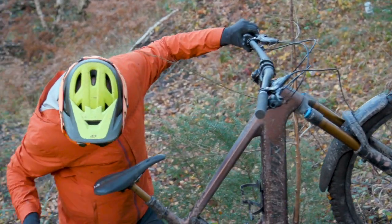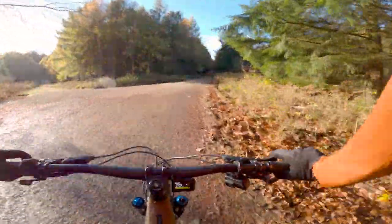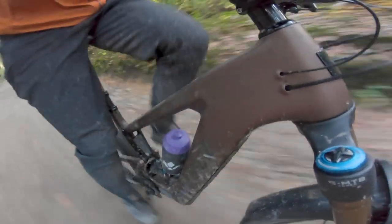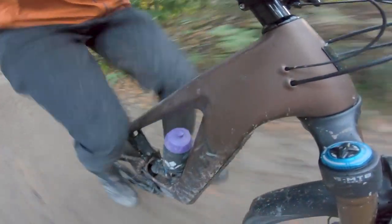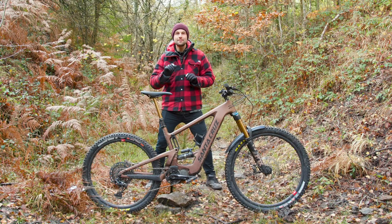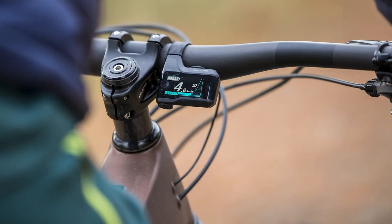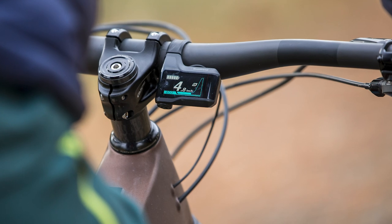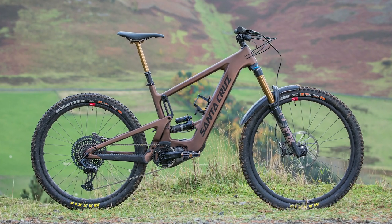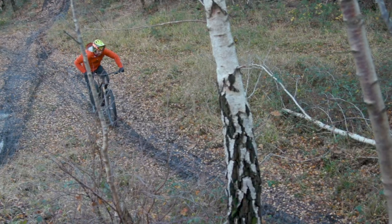Along with the motor, the ascending prowess was helped by the suspension's compliance. Although it would be fair to say that the rear suspension bobs a fair amount under power, especially at lower cadences when standing up, this also translates to an incredibly plush and grip-focused ride. And because it's an e-bike, you needn't worry too much about power loss with bob. The motor overcomes the amount of energy you would lose otherwise from bobbing the suspension.